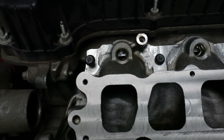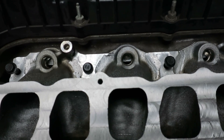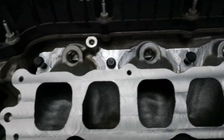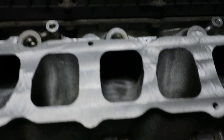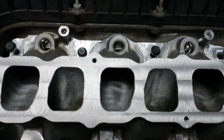You can see down inside the injector holes. I'm going to have to scallop out the head on the EcoBoost engine to give clearance for the injectors so they spray into the port. The ports themselves line up very well — there's probably about 20 thousandths mismatch that I'll have to blend out.